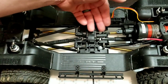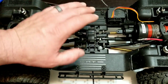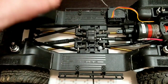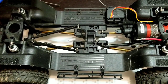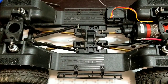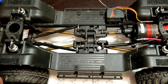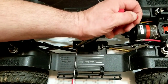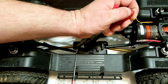Since I already talked about the driveshafts, the transfer case is removed as well as the battery tray that goes on here. Don't worry about that — we'll cover reassembly. I left it out to cut some time. We're done with the transfer case for now. When you do yours, you'll obviously need to remove it first. The first thing we are going to do is remove the upper links — that's where the pliers will come in handy.